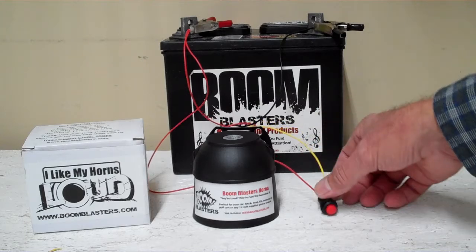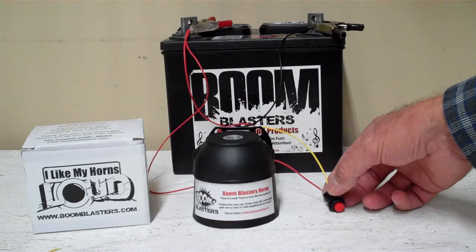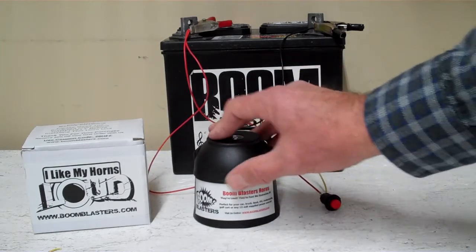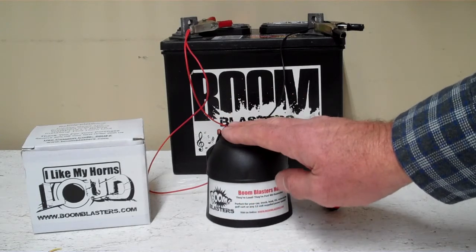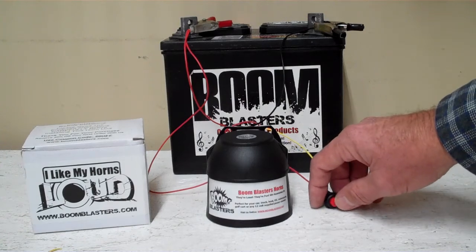The yellow wire coming from your horn will go to one side of the button — there's two legs on the button. Yellow wire will go to one side of the button and you simply run another 12 volts to the other side of the button and you're good to go. We got this thing facing down, it's pretty loud, we don't want to hurt our ears here. This is a cool car horn that we love the sounds here — European Touring Car Sounds car horn.